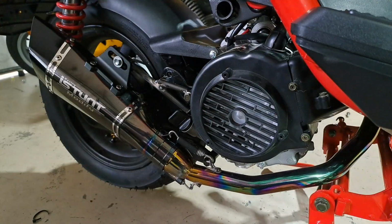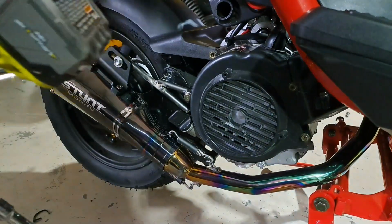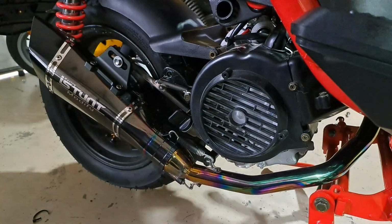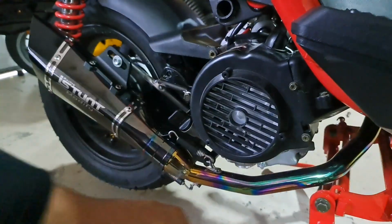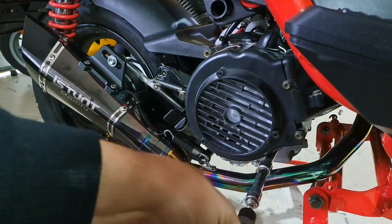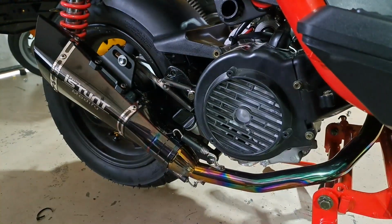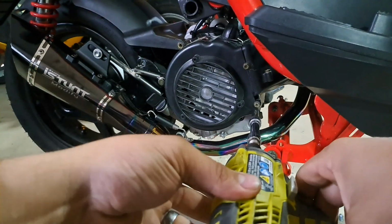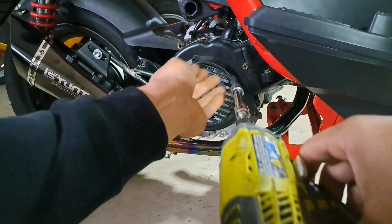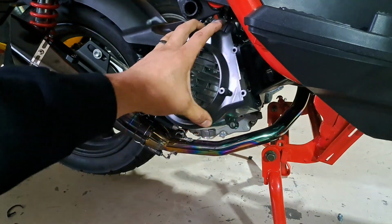So now we're going to get to a part that I've yet to see on YouTube, at least to my knowledge, of an installation of a Benching stator. It's an 8-pole stator. I believe the flywheel is based off of a Jog, since it uses only 3 mounting holes for the fan, so I recommend getting a Polaris 90 fan for a direct bolt-on fit.